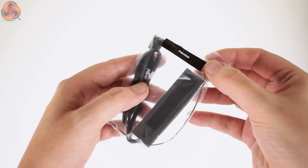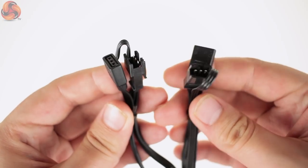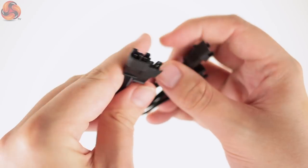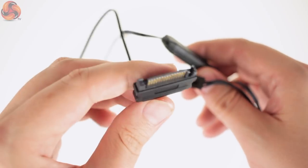In terms of accessories and cables, Deepcool have thought of everything. You get a PWM fan hub for connecting up to four fans, though its triangular shape with all connections sticking out at the top could be a little tricky to install depending on your case — a flat design might have been a safer bet. Also included is a single male 3-pin to 3x female adapter for connecting both fans and the CPU pump, a small 3-pin SATA controller if your motherboard doesn't feature an addressable RGB header, and two extra adapters if it does.